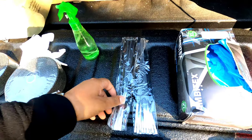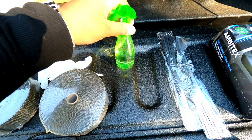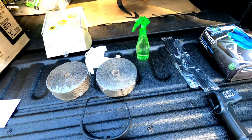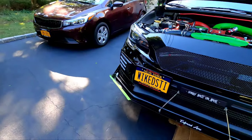Things you're gonna need: I have my own gloves, a heat gun or temperature gun for the end, needle-nose pliers, a spray bottle to soak the wrap and make it more pliable, and definitely some eye protection. Also, wear a long-sleeve shirt — I don't care what state you're in. Even if it's 90 degrees out, wear long sleeves, because fibers from the wrap can fall and cause itching.